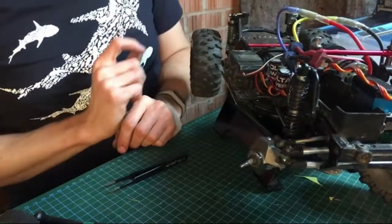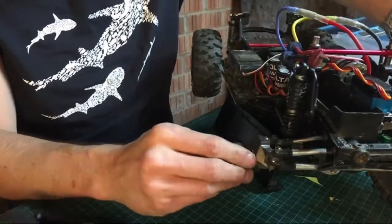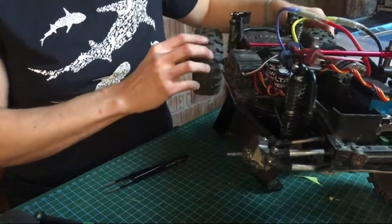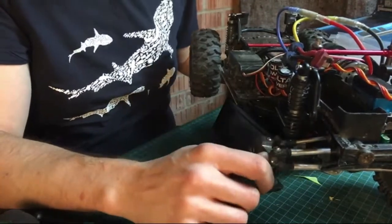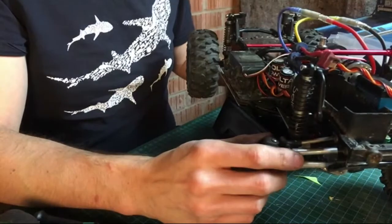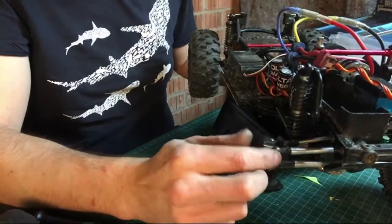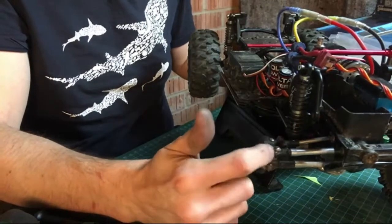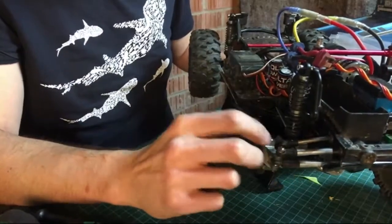Again, Louise Rowdy tyres on this, absolutely amazing, really happy. This thing climbed, given all the slop it's got in the drivetrain and how loose and wobbly all the links are and everything else. Once it gets going, it's just so good. It's a shame that G-Made's hollow balls just wear so quickly. They have these aluminium ones, but the anodizing seems to come off and wear out your rod ends, and the balls just wear out really quickly. It's just a shame. The rest of it is brilliant.